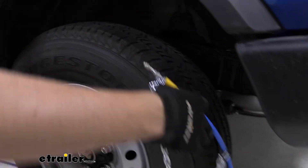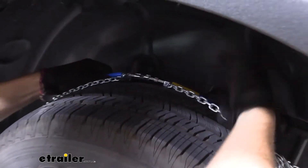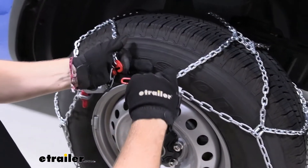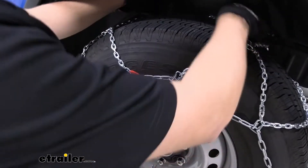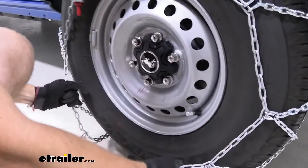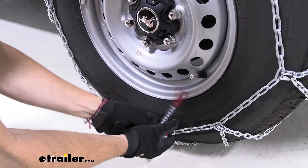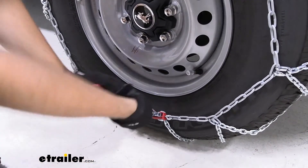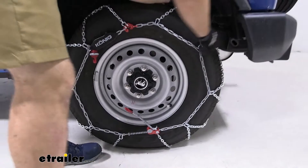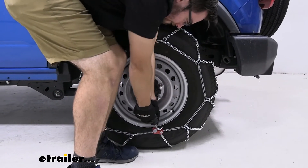Bring my back connection back up and across and start making that first connection. Take our two ends, slot it in like that and allow them to pull — they'll actually hold themselves there. Then grab our top connection here. We're going to go ahead and start with our red for now; we may need to walk that back a little bit depending on the fit. Make sure the chain is seating properly and not getting bunched at the bottom. Now that I have that, I can go ahead and place this right in here, and that's going to allow me to start tightening this up. That's kind of why I left that red one too, because we do have our self-tensioner on here — that's really nice and secure already, and I'm not even all the way secure. Just checking it and making sure my chain is seated properly — it's looking good to me.